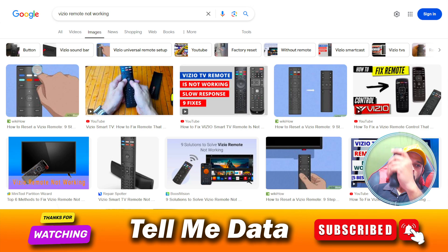You can use any camera, like your mobile camera, to check the remote. Point it at the remote and press a button — you will see a light coming from the remote's IR emitter. If you are getting this kind of light, that means your remote is working fine. You just need to unpair and re-pair your remote with the TV.